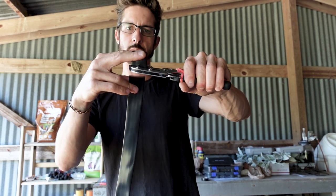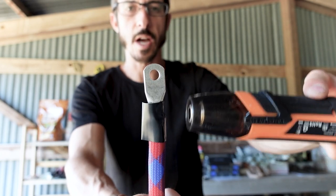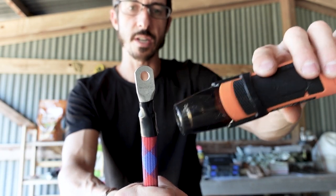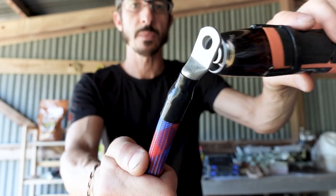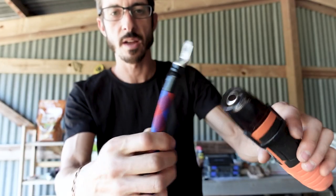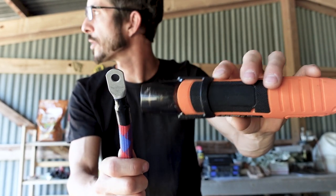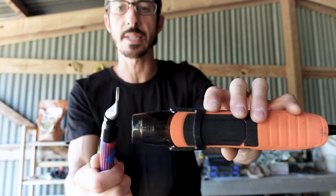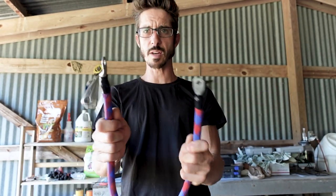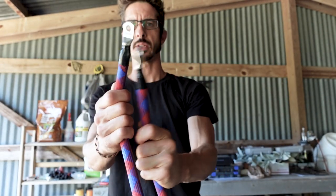Now do the other side with the blade scissors — boom — and put that over the top. Take the time and do it right. There are only a couple of wires to make, so why not make them really nice, make them look good, do it the right way, and know it's going to last a long time. When you show your friends your van it looks clean, neat, and organized — not a big rats nest of wires. And if you ever go to sell it, people will appreciate that everything looks tidy and well done. So there we are — the ring terminal with the heat shrink and the wire loom. Yeah baby.